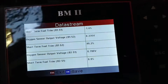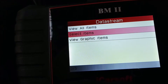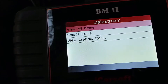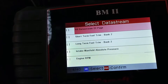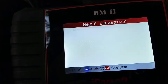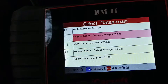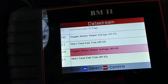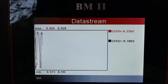It's bouncing around a lot. Let me view the graphic items - I don't want to accidentally back out of it. Just for comparison sake let's also do oxygen sensor output voltage bank one sensor one, so you can get a comparison. These should not look the same - I've done a video on this before with the Crown Vic.